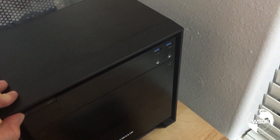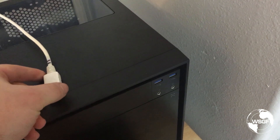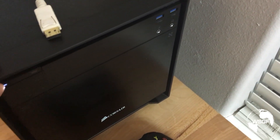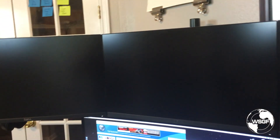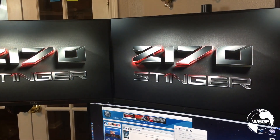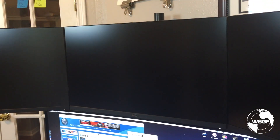I'll force it back off here. What I sorted out was that it was this one cable that was preventing it from booting. Couldn't figure it out, but it did sort out that if the cable was unplugged, it would post and it would boot and it would get all the way to a Windows boot screen - no problem.